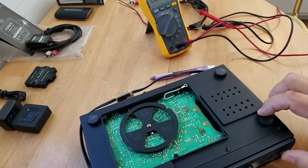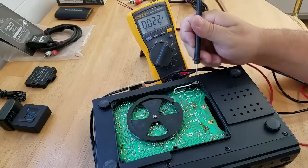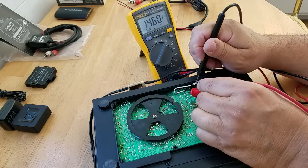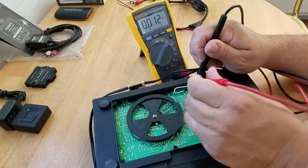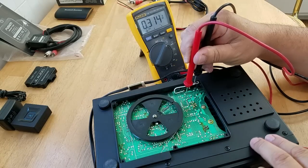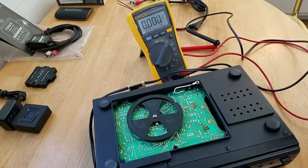I'm going to turn the unit on and put my voltmeter in DC voltage. I'll take my probe, go to the negative lead of the capacitor, hold it on the tab, and stab the positive — sweet, I have 14.6 volts. Now I'll turn the on/off switch to off and let's see if the voltage falls. There it is — this is my switched voltage. Receiver off, receiver on, receiver off. Now we know where we're going to grab power from. That's step one.